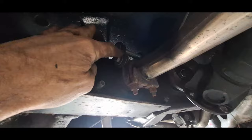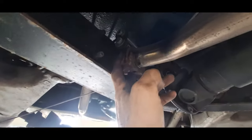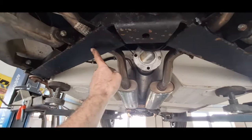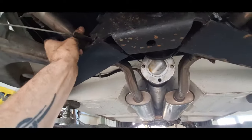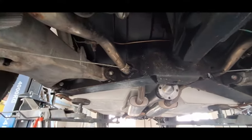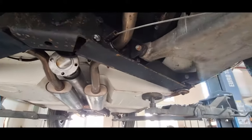On a Stag you also have to take these sections off here - these are the hangers because they're attached to the clamp part behind there. There's a clamp with another clamp behind it - it's a very weird rig-up. If you are restoring your own Stag and it necessitates the move, take this beam and put it on that side and that beam and put it on this side. That then, in effect, flips those brackets around and you can put the hanger here and the clamp there, which makes it significantly easier. I did that in error on the yellow Stag and I thought I'd have to switch them back - but it makes life so much easier.